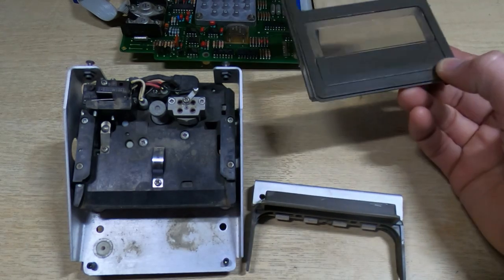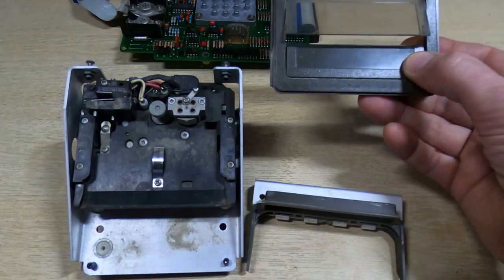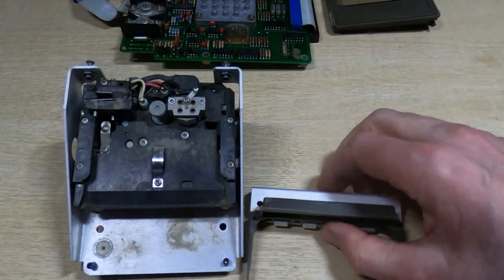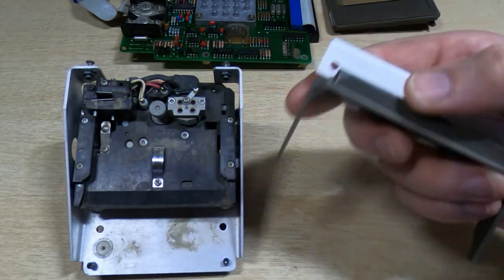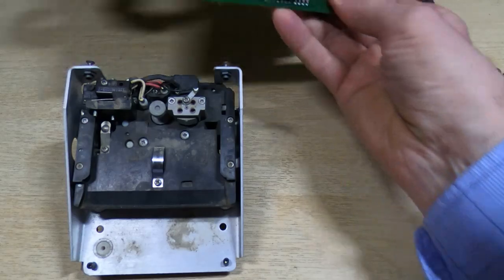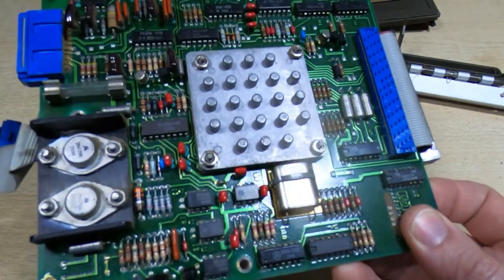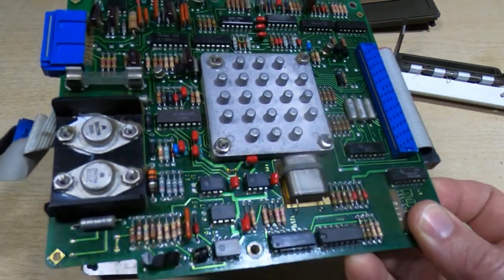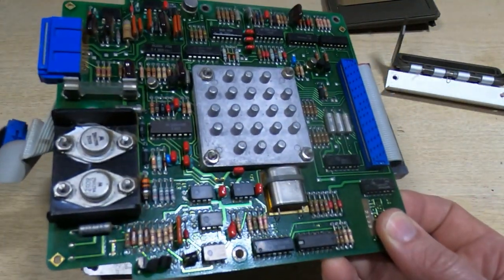The way these work is the two flaps work in opposition. You push the bottom one down with a tape cartridge and it should pop down, but it's very stiff so that will need cleaning. The eject button is just a lever and a plastic button. The two levers are used to push the tape back out once it's been pushed into the tape drive. The control board is quite a complex control system — it includes pre-compensation for the tape data, which I'll explain in the next video. There is one of these boards for each of the two tape drives.